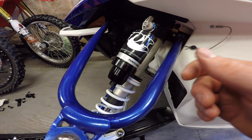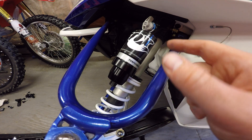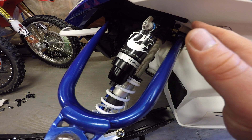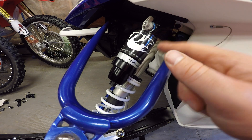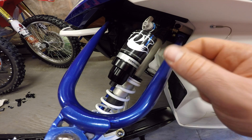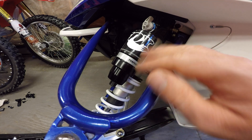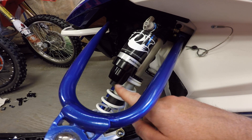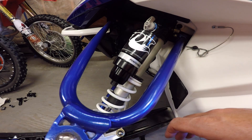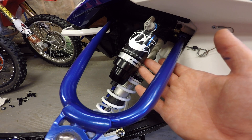The proper way is to put the gauge on the needle and pierce that rubber pellet to see what you're at. With the amount of abuse these shocks take on the trail, you should be servicing them almost every season. My snowmobile has about 5,000 kilometers on it and this was the first service I did. I knew it was getting low on nitrogen pressure, and with the shocks being worn in, I wanted to pull them all apart, put fresh oil in them, and add these high-capacity caps with the Schrader valve to get them back to like-new condition.